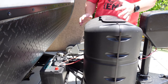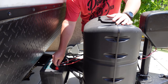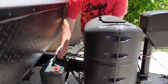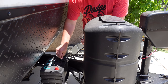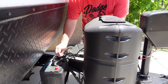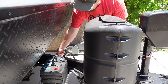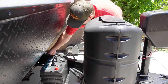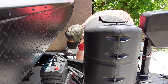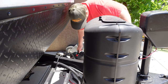I'm actually doing a dual battery conversion as well, so just go ahead and ignore that the box isn't on here and that these are finger tight. I am going to go ahead and remove my battery just to get it out of the way — just remove these cables. Also, I'm going to be working with propane, just to eliminate the chance of any sparks. If you have a battery disconnect, turn that off. So I've got my battery disconnect off. This battery just pulls right out because I've already removed the box.